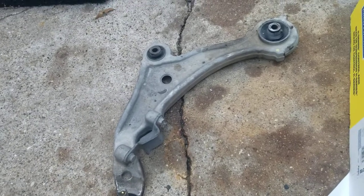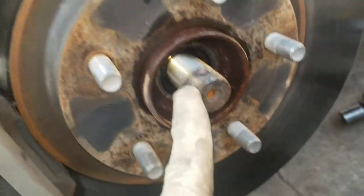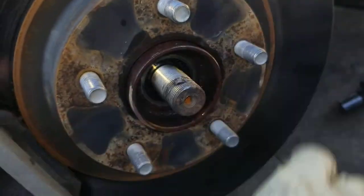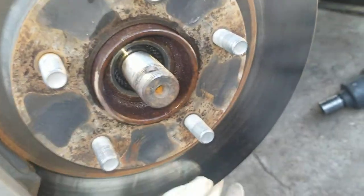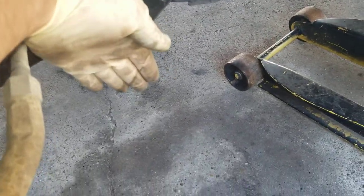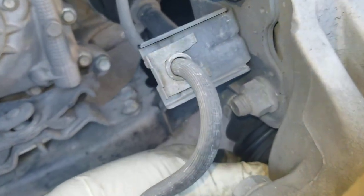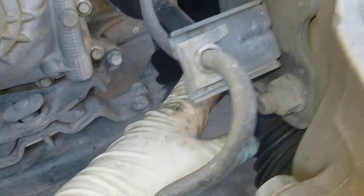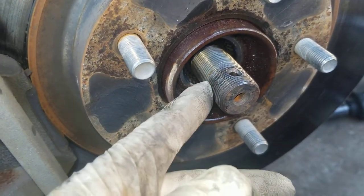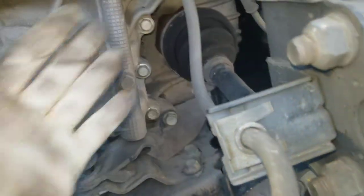So this is where we're at. I did have to take the axle nut off so that I could get just maybe an inch of movement — this needs to come out about an inch. Because when I started prying on this to clear it and drop down, it needed to come out about an inch, and that is just more than this axle shaft is going to provide. You do not want to overstretch this axle shaft. If you don't have a 1-1/4 inch, or 31 or 32 millimeter socket, you can pop the axle from the transmission, but it will leak transmission fluid everywhere.